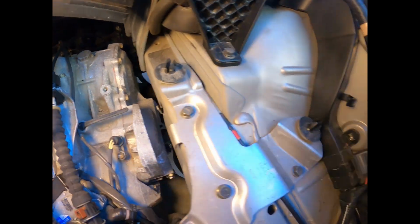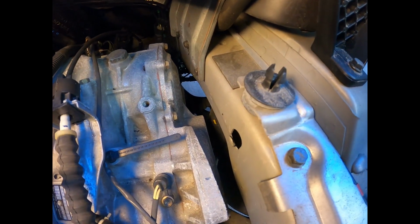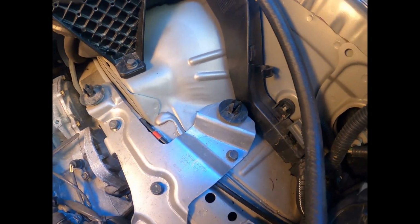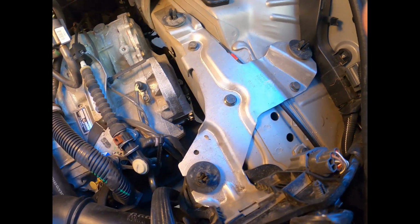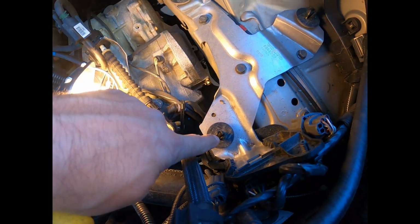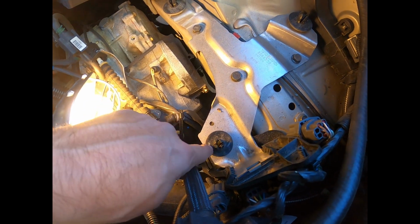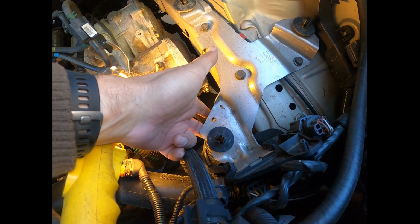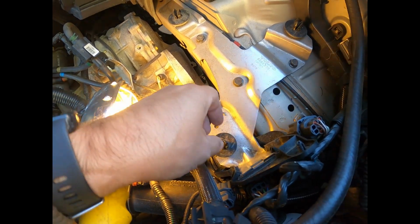They all slide in. You can't just slide it out because these two slide to the left. This one slides to the right, and obviously that's not going to work at the same time. You can't just pull them up. This plastic piece is a solid piece here and extends down through a rubber grommet, and it's got a big plastic lip on the other side, so you can't just pull these out.